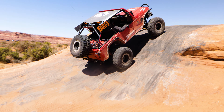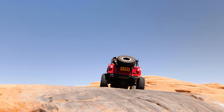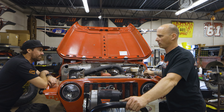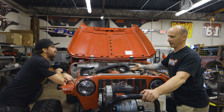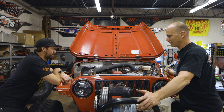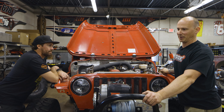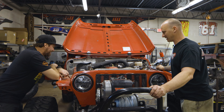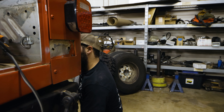The valve covers were venting back into the intake tube. When we wheeled it in Moab we were having oil come out in interesting places. Normally when we set a car up we try not to vent the crankcase back into the intake system. The main reason is if the car rolls over and all that oil feeds back into the intake, you could have a hydro-lock issue. In a normal application it's okay for emissions, but these cars spend a lot of time on their sides or upside down, so we protect the engine. We reworked the vent system and got it squared away.